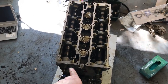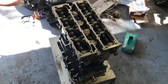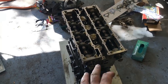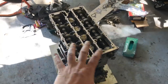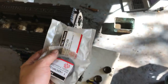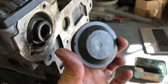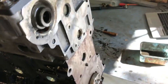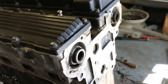After that I'll do the cam seals and the plugs on the far end of the cams. I could have done it when the head was off the block, but I'm going to do it while it's on here because there's less risk of me moving the head and damaging the mating faces. Just popped the old cam seals off the gearbox end of the engine. I'm going to put new ones in — there's no real evidence they were leaking, but might as well. That's been quite a successful day.